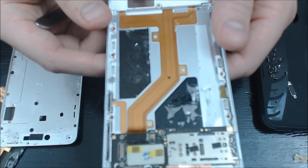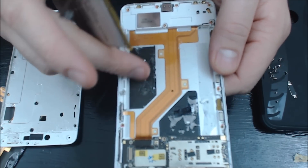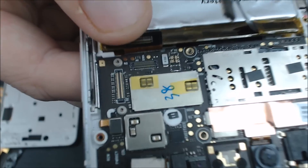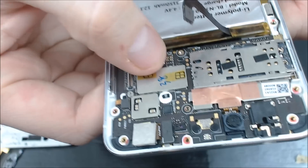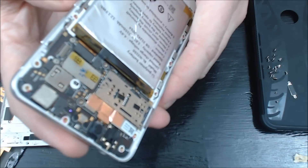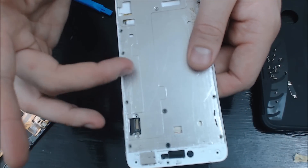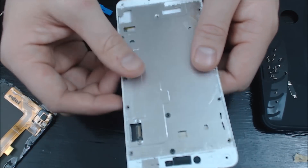So there we go — that's how you remove the battery. We'll pretend this is a new one being replaced since this battery still works. You're going to place some tape underneath according to where the ribbon cables are, make sure you place them on the black tape, then replace the battery. Take the connector and feel around for where it goes — it connects to that little connector right there — and reconnect it. It snaps in. The same thing with the one that goes directly to the motherboard — it snaps in. In all honesty guys, it's that simple. Put your plate back on, then go by whatever process you're comfortable with — epoxy or tape — as shown in my full video.